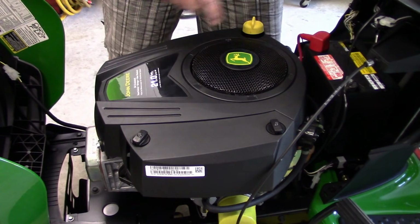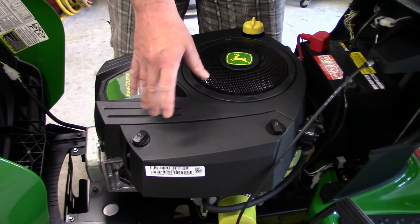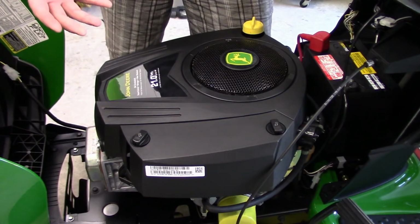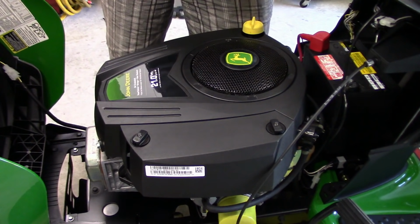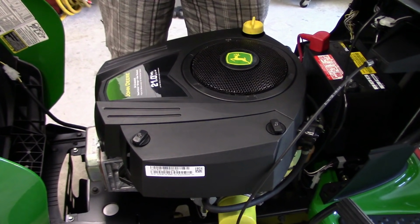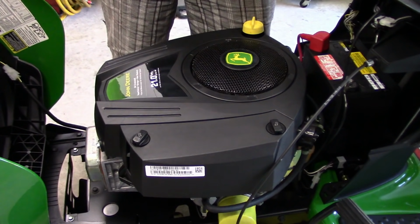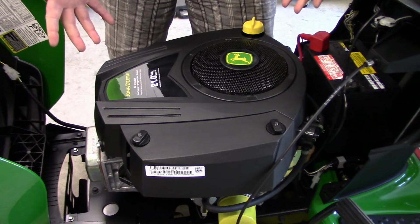That didn't cure it. I even pulled the air cleaning element out and ran it without that, went up a little hill with the air cleaner out, and it was still surging, so I knew it wasn't an air delivery issue. Like the fuel, a blocked air cleaner will usually show up more at higher RPMs, when the engine's pumping more air through it and is being starved of air. So we have to start digging deeper.